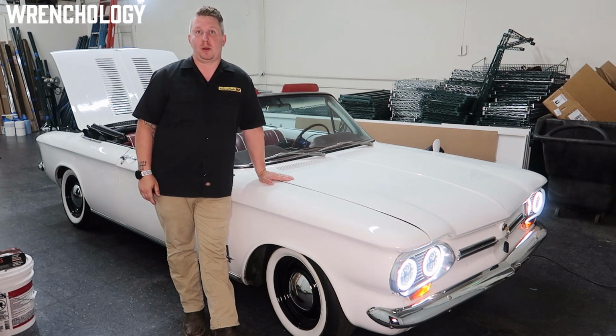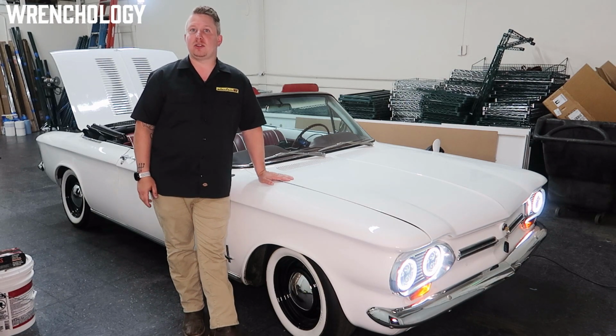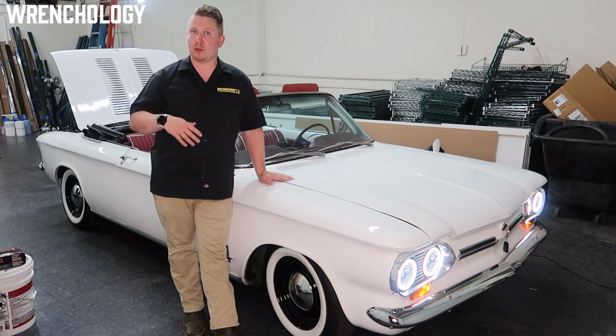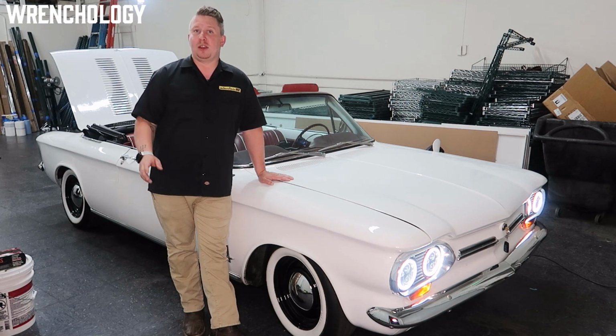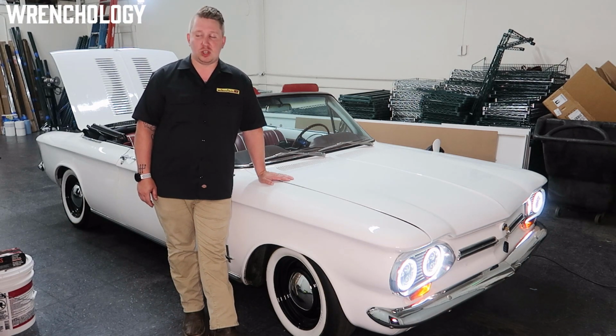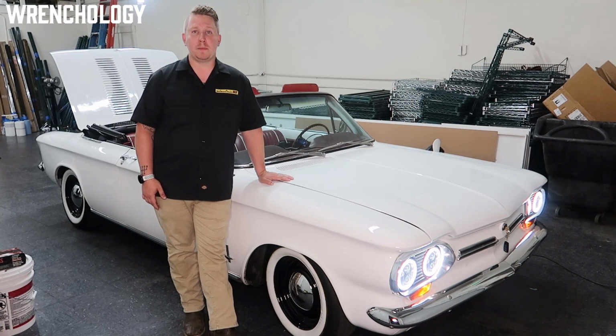Cycle life is what destroys a battery. So we try to keep it in that sweet spot. Even when we store it, if we're done driving it and we know we're not going to drive it for the week, or the weekend, or even a couple of weeks, I try to leave the battery state of charge somewhere around 40 to 50%, because it's one of the best ways to store it.